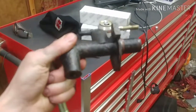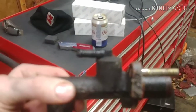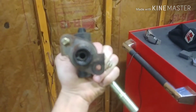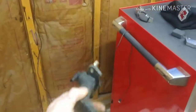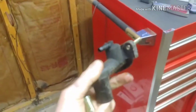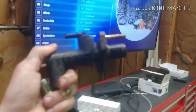Alright guys, this is the master cylinder. It had one flare fitting at the bottom. That's where the rubber master cylinder reservoir to clutch master cylinder soft hose goes at the top. And there is the stud looking at the master cylinder from inside the cabin. So it's in that upper left hand slot. And then on the firewall side, that's the lower stud that it slides onto, and I believe they're both 12 millimeters. So just remove the bracket, remove the battery tray if you want to have just a touch more access, and that's about it.